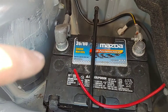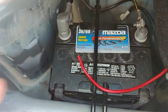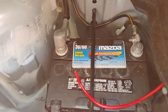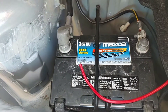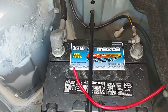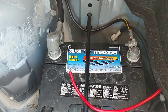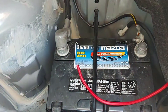Just to clarify something about putting the fuse down here: you're going to put a master fuse down here. This is a heavy gauge wire and I may use additional items up front off this harness, so down here I'll probably have a 30 amp fuse, and that's going to protect in case this wire shorts out somewhere along the chassis or overloads. If we blow the fuse down here, we're good — no car fire. Up front, for the fog lights, they'll be fused separately with their own 15 amp fuse. So if something goes wrong with those it blows that fuse, and if the main line is overdrawn it blows the fuse down here. That's how that works.